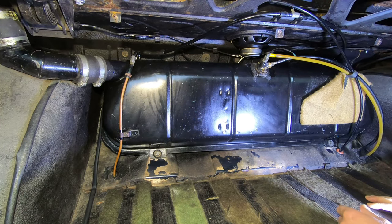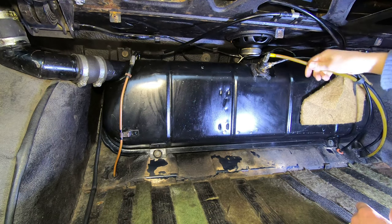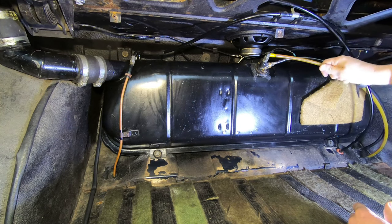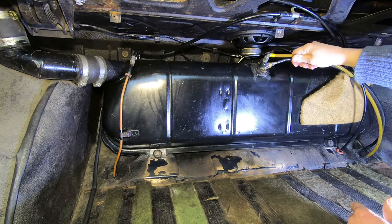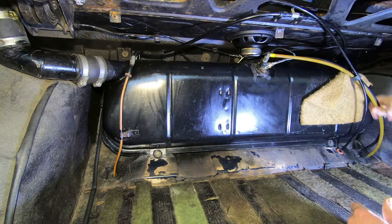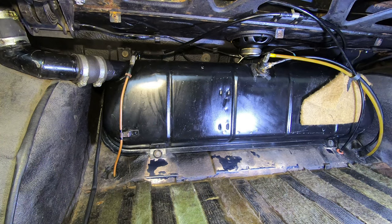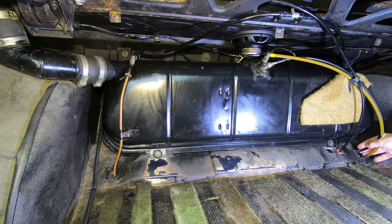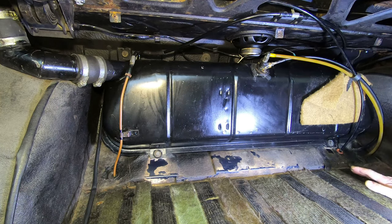These two pipes, I think, are original Rover pipes. They look okay but they are very hard - almost like nylon or some sort of plastic. I'm going to replace these. They go through the boot floor and there are actually no grommets on those, which isn't great. These then go to the reserve tap, and from the reserve tap there's a single pipe going to the engine.